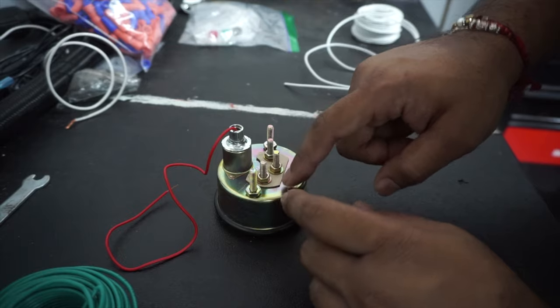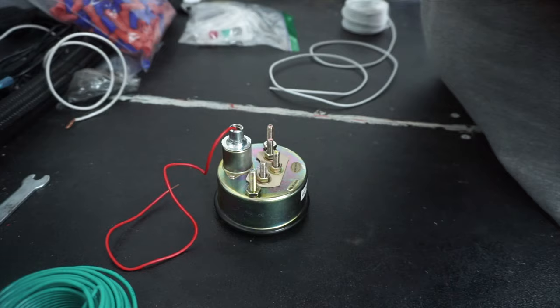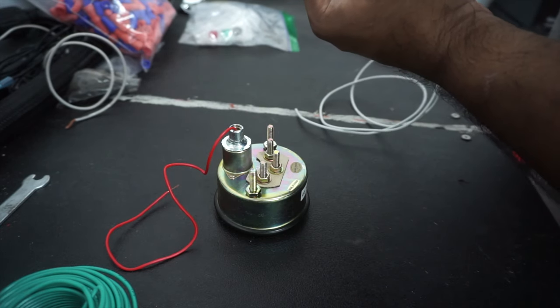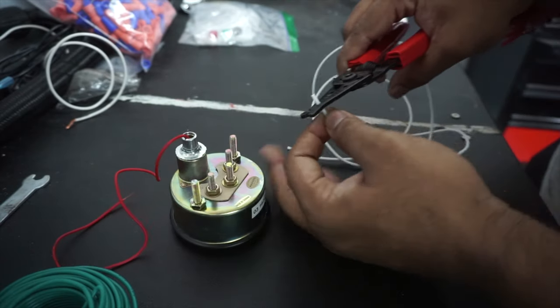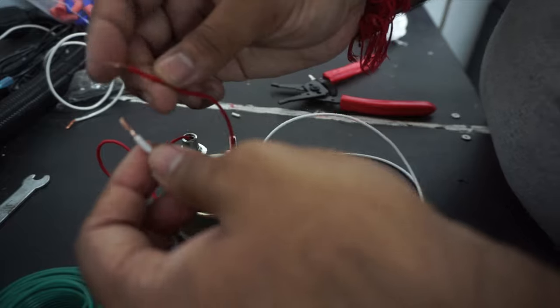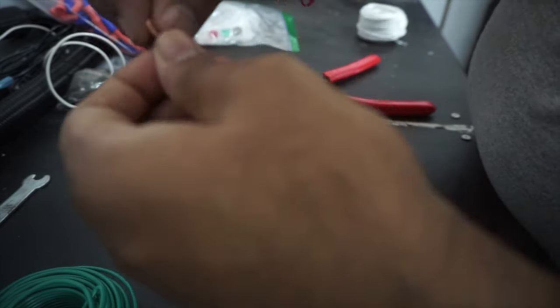The only long one I'm gonna need is probably just the sending unit wire. I got my snips and I'm gonna cut right here — this will be 18 gauge. Both of these I'll definitely be soldering in the future. I'm not sure why they want 18 gauge because this is definitely more like 19 gauge. In the meantime I'm just gonna have these on wire nuts.